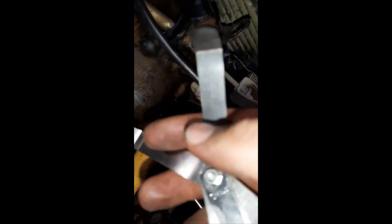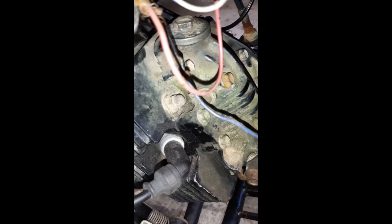Okay, this one's done — I busted my knuckle. It's very hard to see. This one right here I set at 0.003, and this one — the intake side — I set at 0.002, which is in between one and three thousandths. That was the intake side, which I'm done with now. Setting these things with the motor still in the frame is very very challenging, especially without an offset wrench. Now I'm gonna move down to the exhaust side.